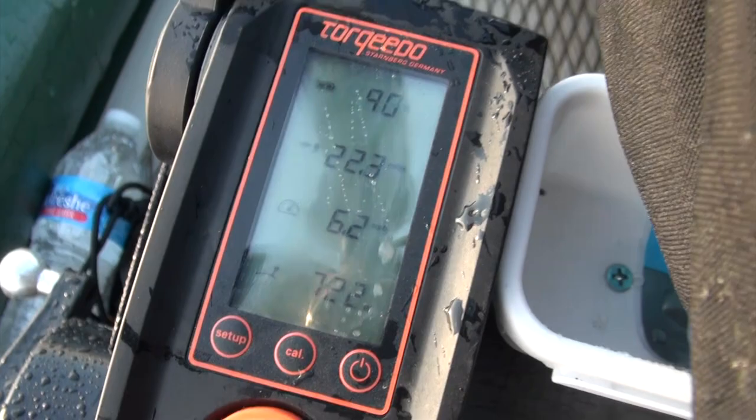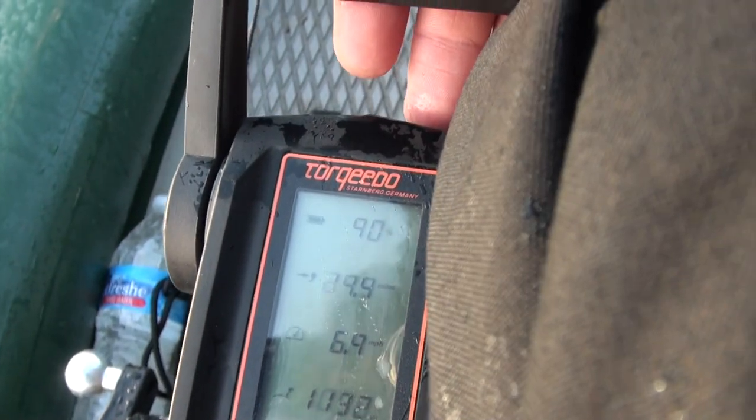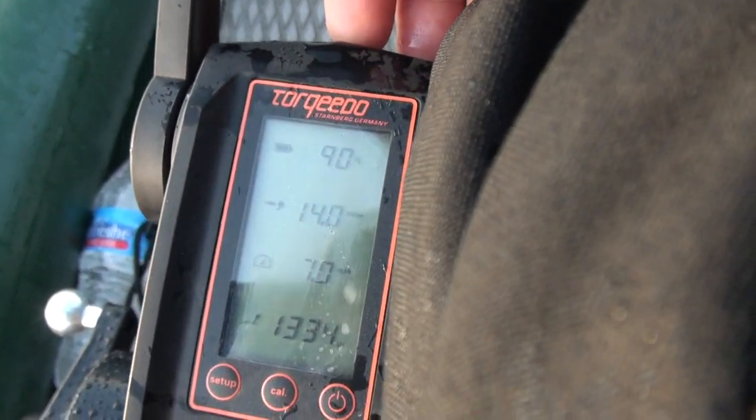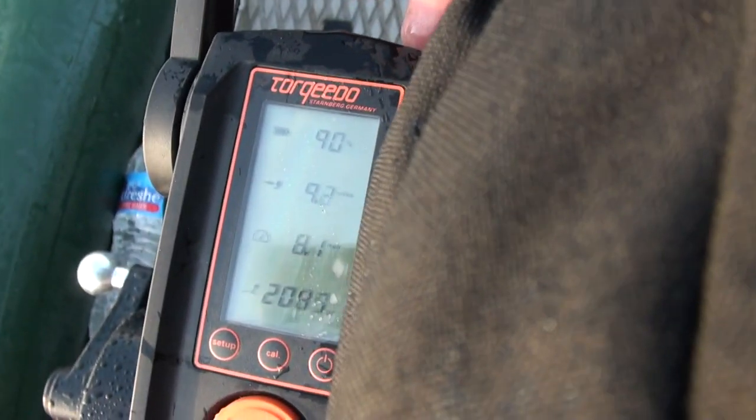So I'm going to go ahead and crank this up and give you a little bit more speed, and you can see that remaining range is going to go down. But if I don't want to use all 2,000, and this goes a little bit higher than 2,000 watts, then I back it off. And that gives me an idea of, hey, if you cruise along at under 200 watts, you got almost 80 miles of range, even with 89% of the battery remaining. So the harder you push it, the quicker you use it, but there is a nice cruising speed.